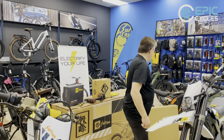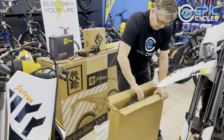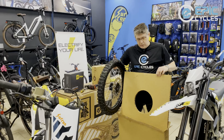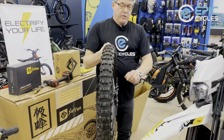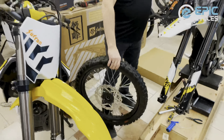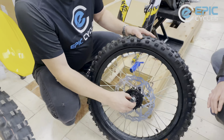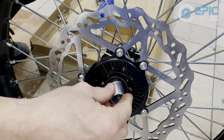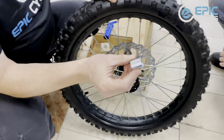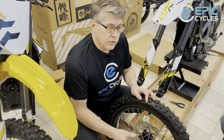This box houses our wheel — very carefully packaged. There's a disc brake protector, a nice robust large disc brake — very thick, very strong. The tires also appear much larger in section. Putting the spacers in: the flange goes towards the inside. There's a lip seal that is a wiper to keep dirt from getting in. Spin the wheel around — flange towards the bearing, rotate that in. If you drop it on the floor and there's dirt on it, wipe these down — you don't want to introduce dirt into these brand new bearings.